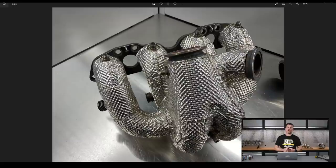This is significantly more effective than heat wrapping. We had originally put heat wrap on the manifold, and obviously there's a range of different qualities of heat wrap out there. It works reasonably well on exhaust downpipes, but the manifold itself — in operation this thing is going to be glowing red hot, probably up around 900 degrees C — and just getting that heat wrap to last a reasonable amount of time is really tricky. This is laser welded in place, so we've got no risk of it falling apart.